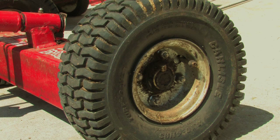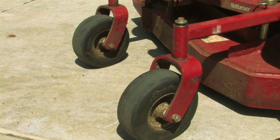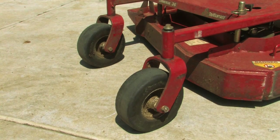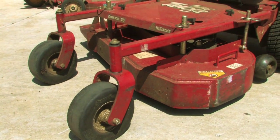On all our wheels we have what's called a Zerk fitting. Let's go up here to the front — it's the easiest one to look at. Right here — make sure we grease these. There should be Zerk fittings on any moving parts on this machine. Save your bearings; they get kind of expensive.